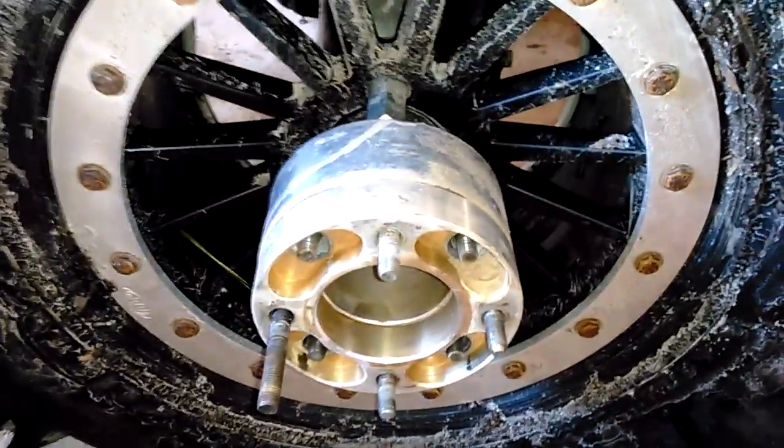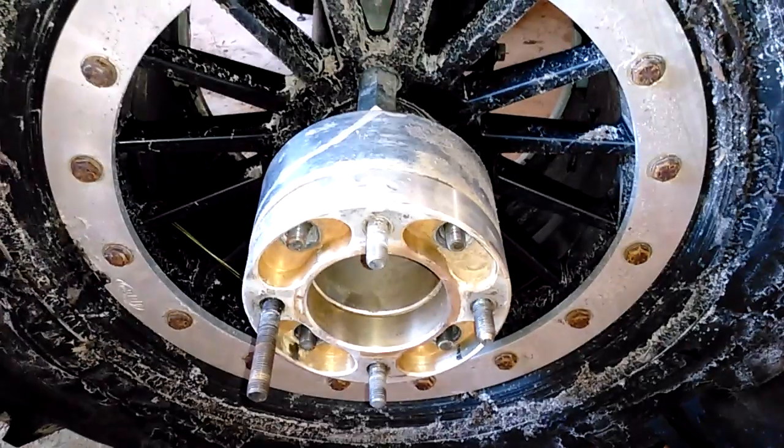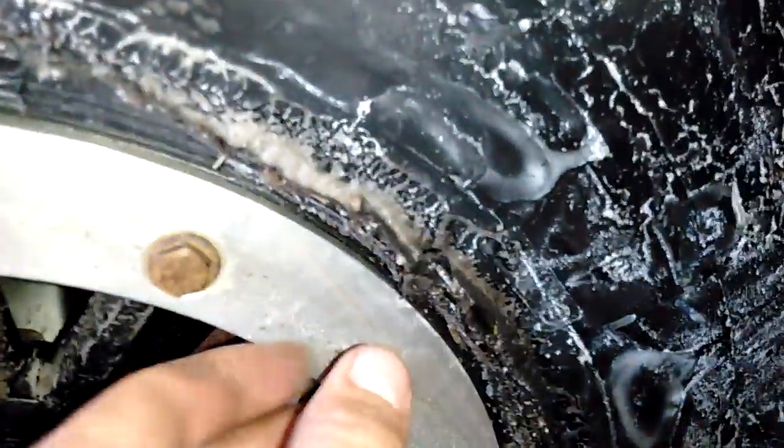So make sure your inside tire is at the air pressure you want to operate this at before you bolt it together. You actually see that it's making such a good seal that all this mud is getting trapped in between the 2 wheels, which is kind of a nasty side effect of having dualies, as dirt gets caught between them. But like I said, you really want these 2 wheels sandwiched against themselves. That's what makes it strong.